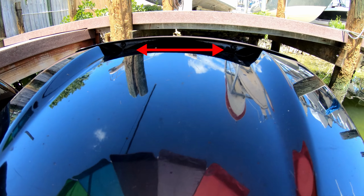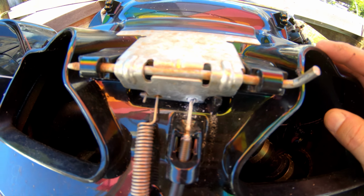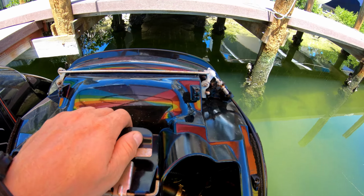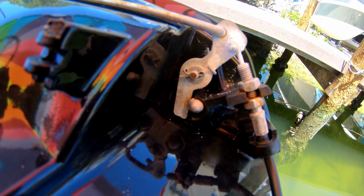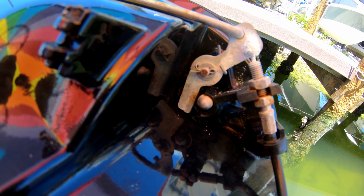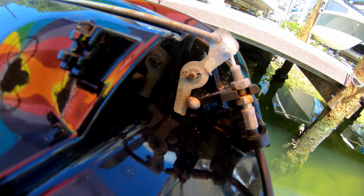After you pull the cover off, here's your handle. There's this metal pin here that you can flip up and pull out to remove the handle and the cable. With a working cable, when you pull up on the handle, it pulls the 2 tabs hooking onto the back cowling. After you change your cable, make sure to adjust it here with 2 10mm wrenches.